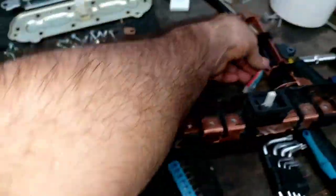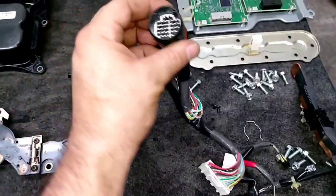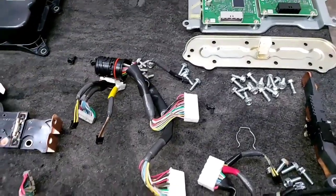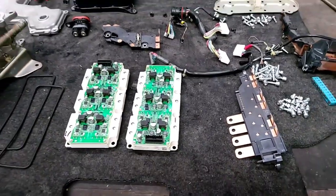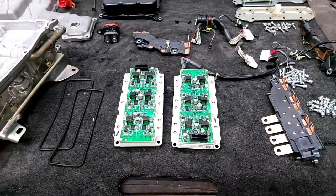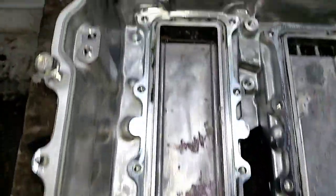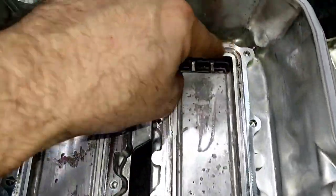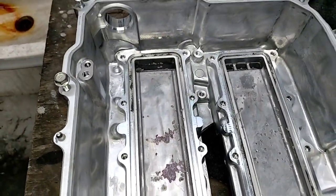All of these are the main wires for the management computer, and this is the main outlet. I just wanted to show you. Before assembly, I'm definitely going to service this track where the seal of the IGBT cooler is, otherwise we're definitely going to have an issue — it can actually kill the inverter.